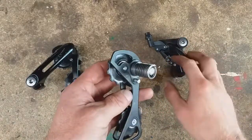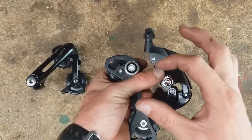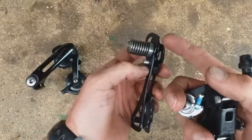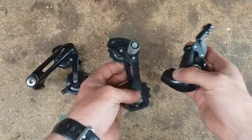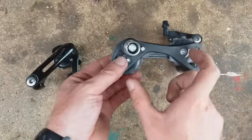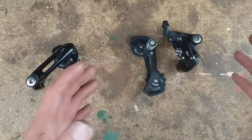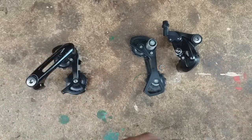So I'm just going to put this back together, put it back on the bike, and for the moment I'll just have a short tail of cable, just adjust it here until the derailleur lines up with the one sprocket, and leave it like that - that should work at the moment. But that's a more realistic length that I need for taking up the slack, because the whole point of having two chain rings is that they have a large difference in size, so that they get a really big ratio range.